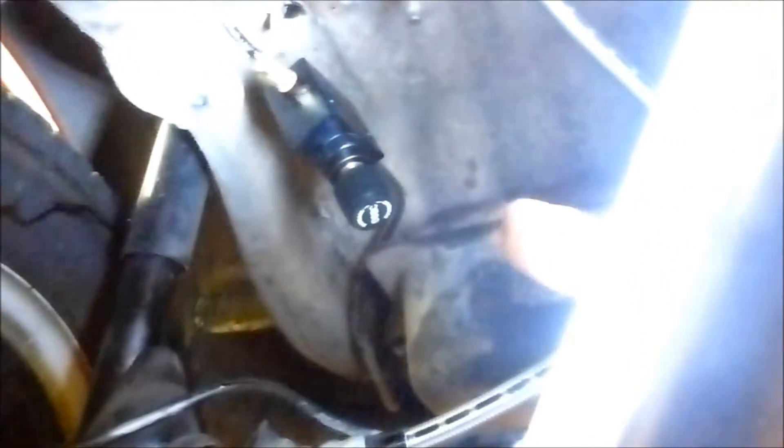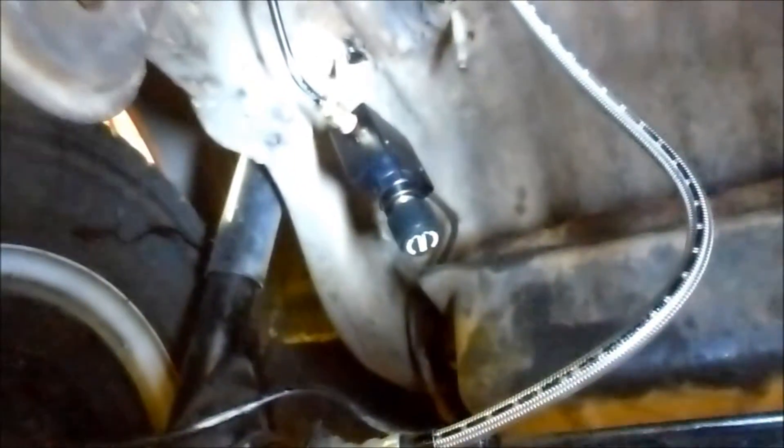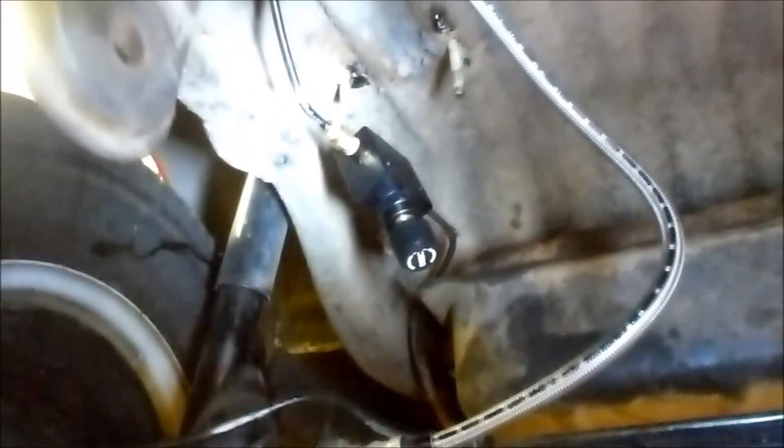I was having problems with the rear brakes locking up too early. So this is an adjustable brake proportioning valve. The stock N600 does have a little valve there but it's not adjustable, and I put this in. I had to adapt the fittings because there are no metric adjustable proportioning valves, only standard. So I had to cut and flare some new fittings — it took me a couple hours. But I now have adjustable bias for the rear brakes and I already like it.